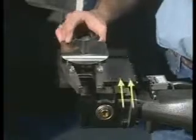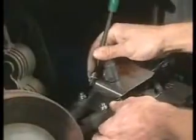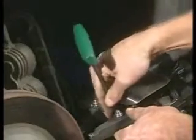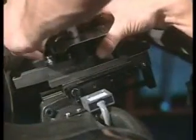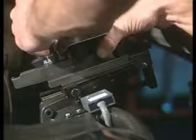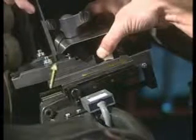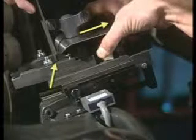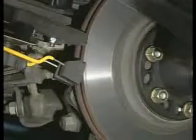The cutting head must also be set. Notice the series of tapped holes in the slide plate and the slot in the cutting head. A 6mm T-handle allen wrench included with the lathe allows you to move and center the head so the cutting arms will straddle the rotor. Before tightening the securing screw, it is absolutely critical that you firmly press the head back into the dovetail groove in which it rides. While one hand is tightening the screw, the other hand must be firmly pushing the head back into the dovetail. If you fail to do this, surface finish will be compromised.